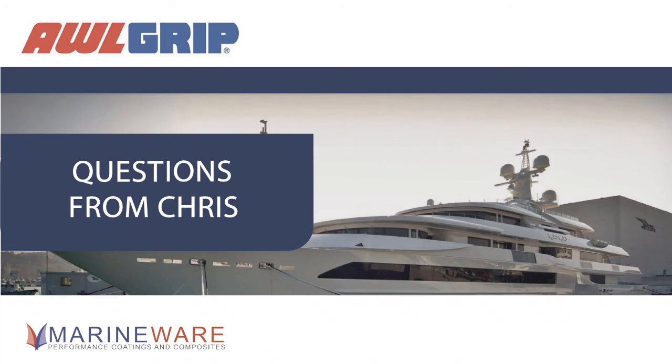Q&A: If you prime components in Quick Build surfacer in the morning, come back after lunch to sand, and start to sand through in a few places needing more primer — can you apply surfacer again? Yes. Or you could flash a bit of sealer over just to cover the sand-through, as long as you're using the appropriate sanding method and sand scratch won't come back through. If you're concerned, go over with surfacer again and re-sand just that area. It's got a lot of scope and can certainly speed up small boats and component work.